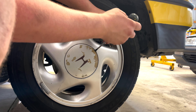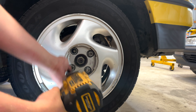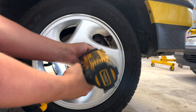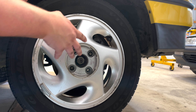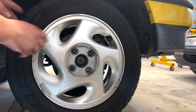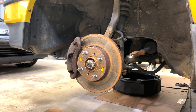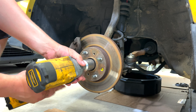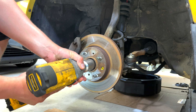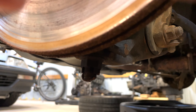I'm going to do the same thing for the passenger side. There's an R here which means right side — just an indication of which side the wheel should be on. Start by taking that axle nut out. Remember, if there's a dent in it there's a little pin you have to straighten out; sometimes it's looped around the threads and that has to be removed before you can take the crown nut off.